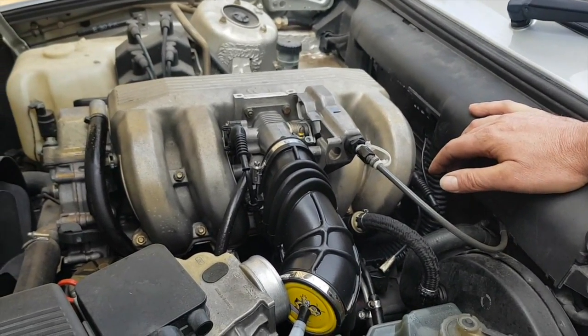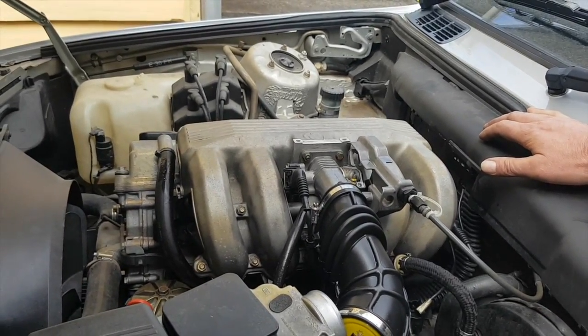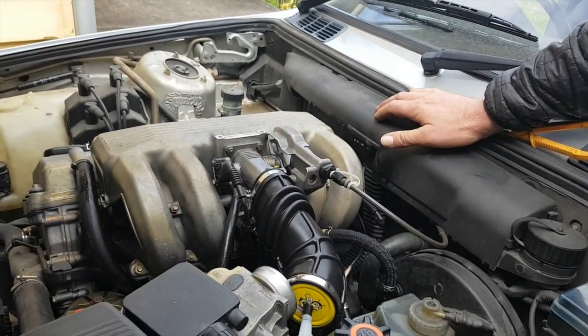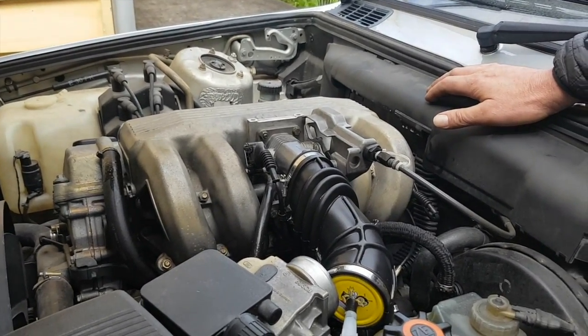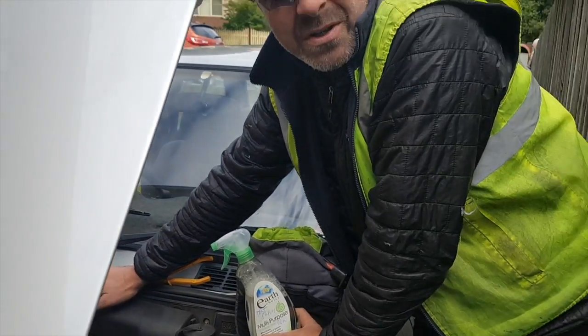The thing that you really need with a smoke check is a still environment to use it, so you can see where it's coming from. Yeah, and a very bright light to highlight the smoke, which is either going to be, say, an LED torch that focuses, or a laser pointer. Yep.